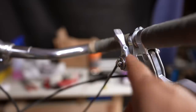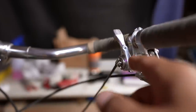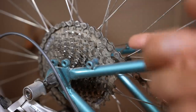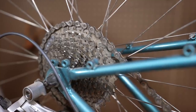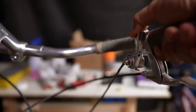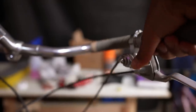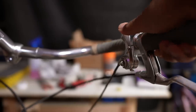I'm going to show you how it affects shifting and where in some ways it actually makes more sense. This is a left thumb shifter put on the right side and turned upside down. This is its position where there is no cable tension. On a non-Rapid Rise rear derailleur, this would set your bike up in the hardest gear. However, since it is a Rapid Rise derailleur, you can see that it is in the largest cog or the easiest gear — the default no cable tension position. So as I shift and pull cable, this actually shifts it into a harder gear, which is the complete opposite of other derailleurs. Shifting to a lower gear is super easy — it wants to go there on its own volition, so not a whole lot of force needed.